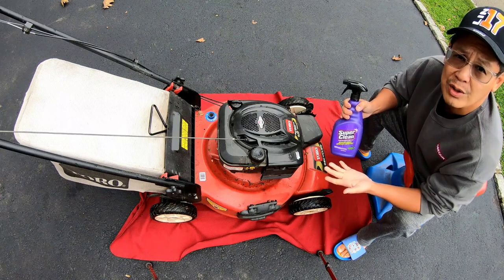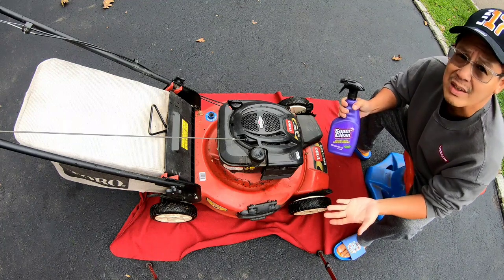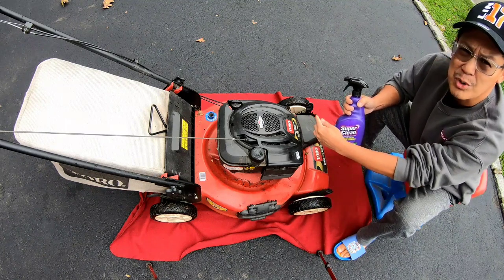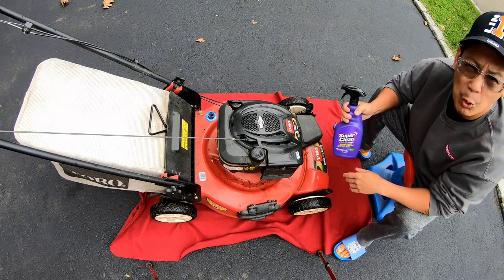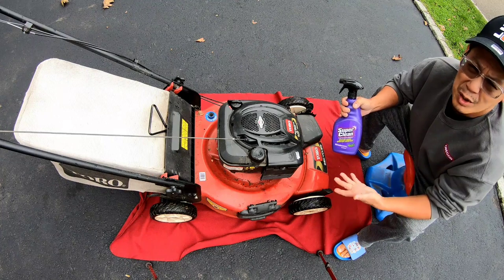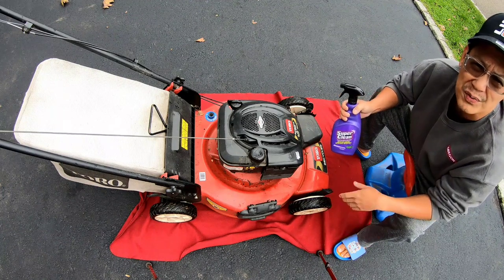So I just brought it out to the front over here and started it up again. Let it run for about a minute or so, and it didn't surge anymore. So, initial cold start, you know what I'm saying? It takes time for the muffler temperature to reach an area where it'll push the choke flap completely open and then run right. Maybe it's got some bad gas in there, but it doesn't surge anymore. So just let it run for a little bit. When it warms up, it runs just fine.